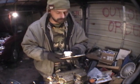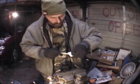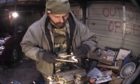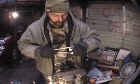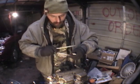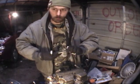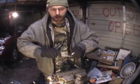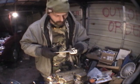We're threading into an aluminum block with a finer thread to get all of our torque. We want to make sure our threads are clean — get any carbon and funk off of them — and we want to oil them. The best way to clean these is a wire wheel on a bench grinder, or a wire wheel on a drill, or even just a brass wire brush. Get all the funk out of the threads and oil them. The idea of oiling the threads is so we get our torque readings properly, because dry threads create resistance that falsifies the torque. We want it to go in smooth, torque up, and get a proper reading. We have a somewhat complicated torque pattern — you'll get to see that in a second. I'm going to get these bolts ready and then we'll bolt this thing down.